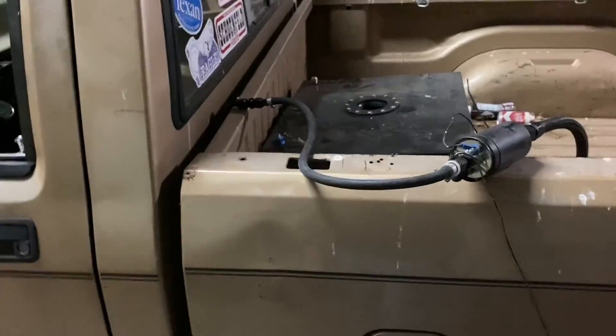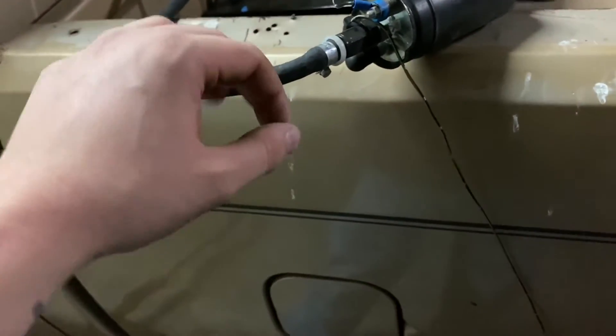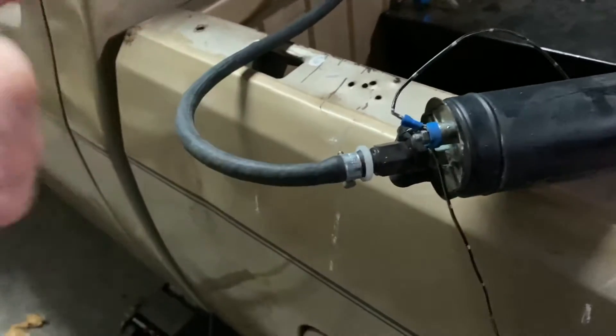I've only got my 5/16 fuel line — I've got five feet of it, actually a little more. Just because this is what most stuff uses. Look at that 90 — oh my god, it's so clean. I think it's actually a 45, yeah, a bent 90. Fucking AN fittings. That fresh 90 on there, man — this is so cool. I'm mocking people, by the way — don't take me seriously. I don't really like AN fittings, but all this shit came with AN fittings so I had to go to AN fittings to adapt it. I just like hose barbs. Slide the hose on there, put a hose clamp on — bam, good. It's rated to like 70 PSI without a clamp, like 150 with a clamp. More than anything you'll ever need. But it doesn't look like a race car — it's like a quick-release steering wheel and shit like that. Dumb. Wasting money. Be smart, just get barbs.